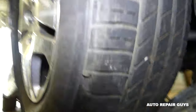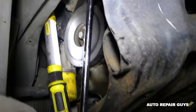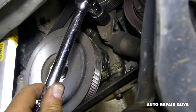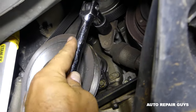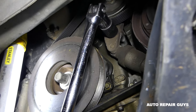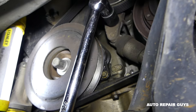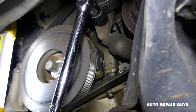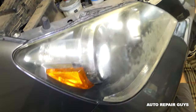You need to remove your fender underliner — the splash guard — and get a 19 millimeter socket. Right there you can see the tensioner pulley, and we're going to compress that. You need to apply quite a bit of pressure. This is pretty much a two-person job.